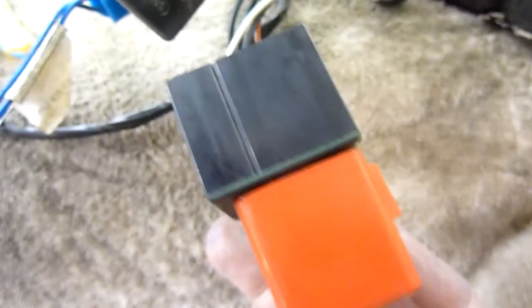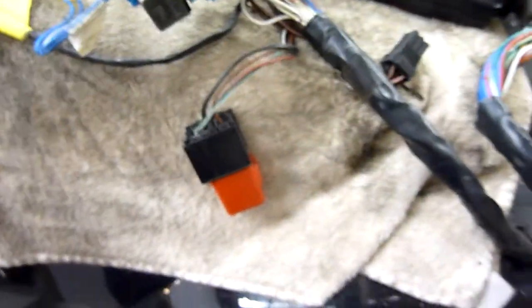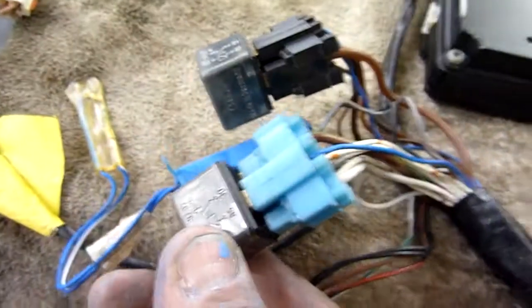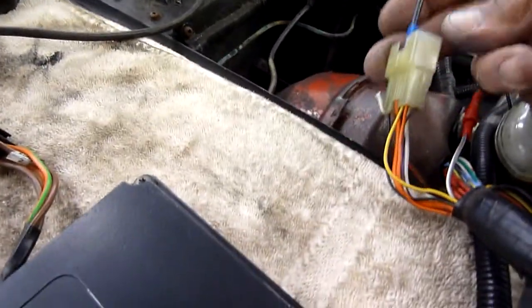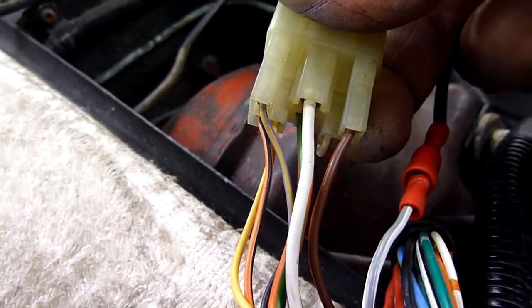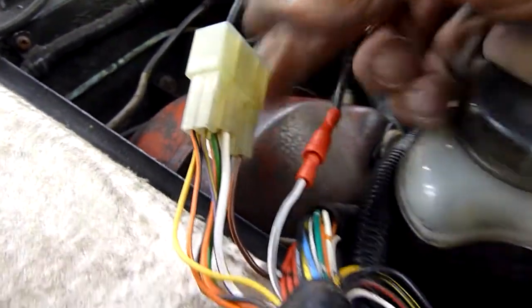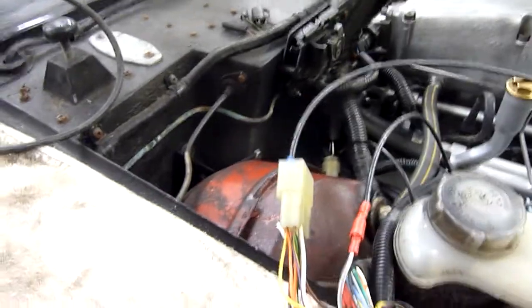Now, I was confused by this one - skinny wires, in this particular case an orange relay. I didn't realise that you don't need that; it's to do with the air conditioning. You actually don't need this one if you're doing a different fuel supply. But if you are using the ECU to control the fuel supply, then you will need it. On the other side of the main connector you will see a quite heavy white cable - that is the electricity to power the fuel pump when the computer says the time is right. I have not used it because this car is running a slightly different system and the fuel pump will be controlled in a different manner.